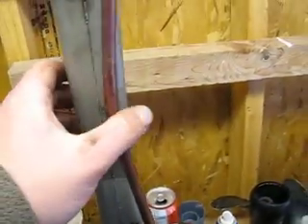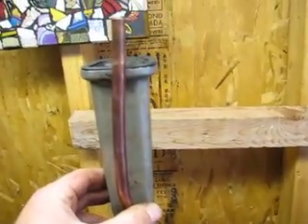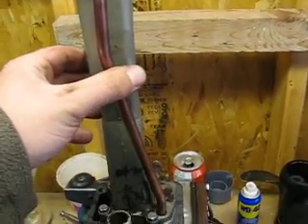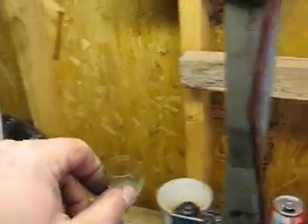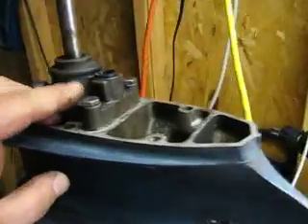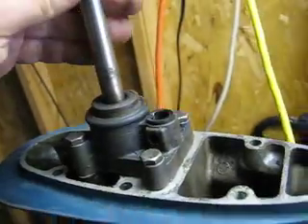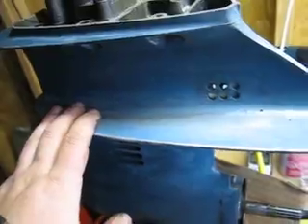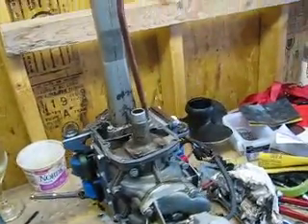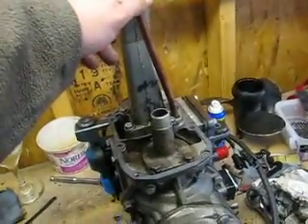Took it apart and put it back together. One thing you've got to make sure is your water tube goes back in the same way it came out — they can angle at different angles, so this tube could be on the other side, in which case when you go to reassemble your motor, it doesn't match up with the pump. The tube slides in there, and as the power head rotates, it pumps water into the tube. You want to make sure you do it right the first time. This is actually my second video of this motor, as I had the tube in the wrong way. I've spun it around since, and now everything matches up.